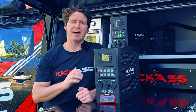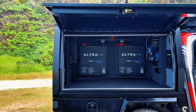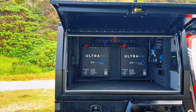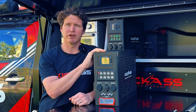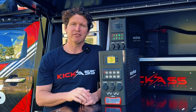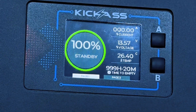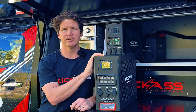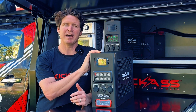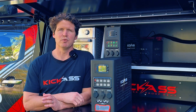The first thing I need to mention is that this canopy system has been designed to be used specifically with our Kick-Ass Smart and Ultra X batteries. That's because the integrated battery monitoring system connects directly to those batteries via RJ45 connector. On the display screen here you'll get the SOC, voltage, real-time current, time-to-full, and time-to-empty calculations, as well as any alerts from the battery management system.